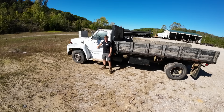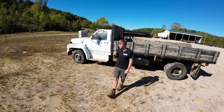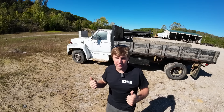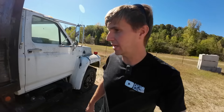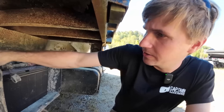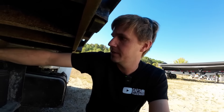This is our 1993 Ford F700 dump truck that we picked up for $2,000. In the previous video we got it running. If you want to see the process I started a playlist you can check it out. The engine was slightly locked up — we changed some plugs, some wires, that kind of thing, threw some fresh gas in there, and after a few cranks it did what we were hoping.